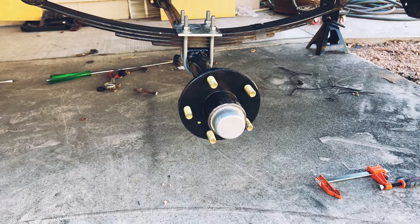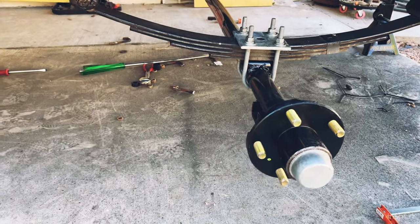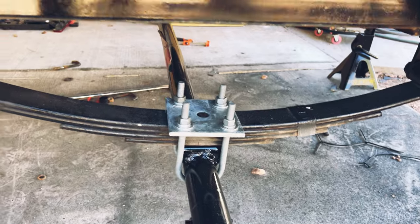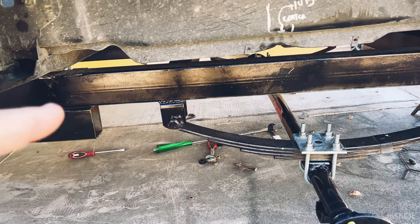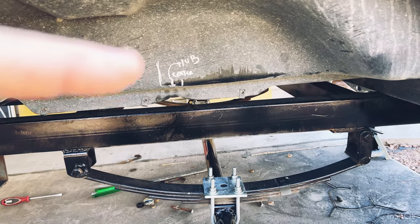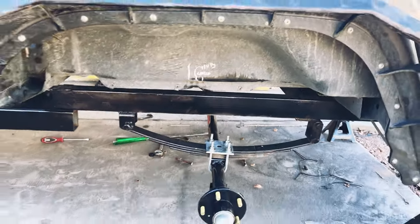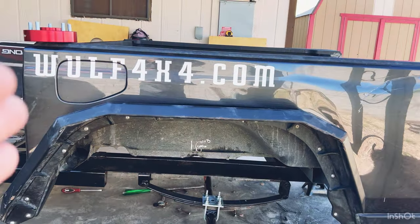It's a 2,000-pound axle. I don't need a 3,500-pound axle — I'm not hauling that much stuff and don't plan on it. I've got the 2,000-pound Dexter axle. I've loaded on some new perches there to mount it up, but I actually have to move these over about 4 inches, almost to the edge of this frame. As you can see from my markings on the bed and the hub itself, it's off. I've got to center this hub over so when I put the wheels on it looks centered like it's supposed to.